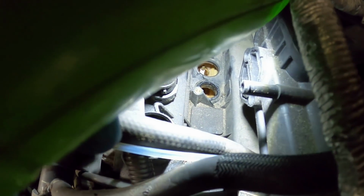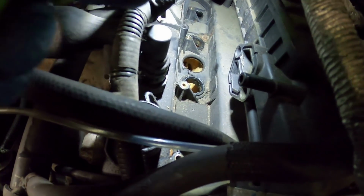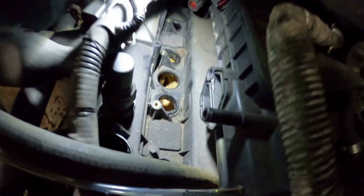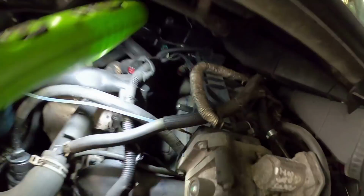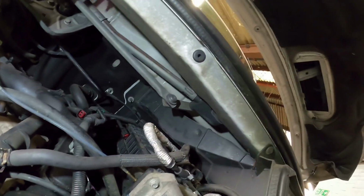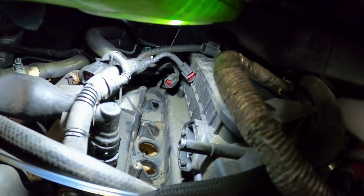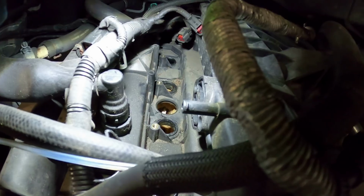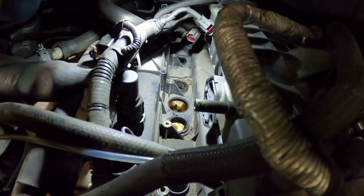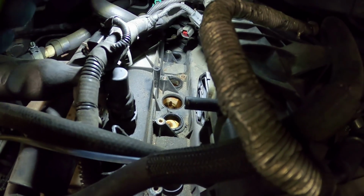There is obviously water down there at the moment, so I can only assume, because it doesn't actually look like antifreeze, it hasn't got that pink staining, I can only assume there's quite a bit of staining across the top of the rocker cover. So I'm thinking water's getting in from under there somewhere, and maybe it's running down the scuttle and dripping into the coil hole. So I'm hoping that's what it is. So I'm going to suck all that water out, blow it all out and then leave it pumped up for 10-15 minutes or so and see where it goes.